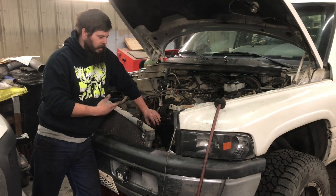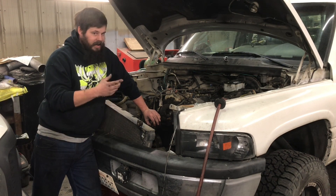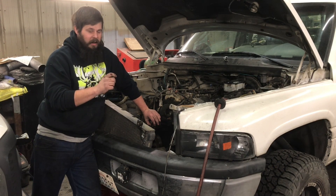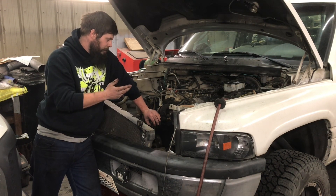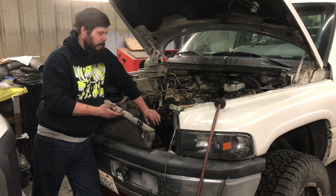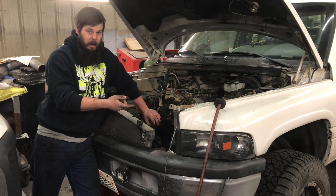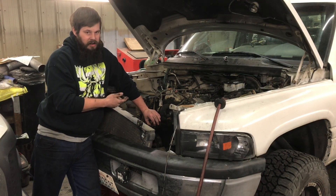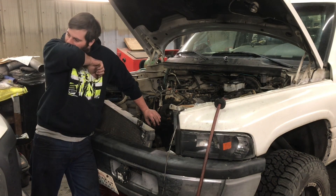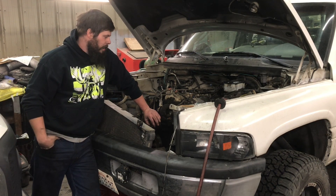In the later trucks, it went into bending push rods. The weakest link is either going to be the bolt or the push rod. Because the lifter can't compress, it's going to find the next weakest link. These aren't an interference engine in the traditional sense, but the interference comes in with the push rod over-traveling the rocker. I was driving to work a couple days ago and started getting another misfire, with rattling noise in the top end again — I'm pretty sure she broke another rocker bolt.